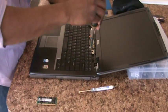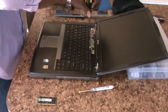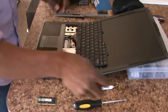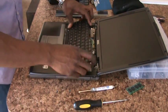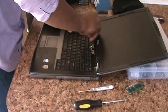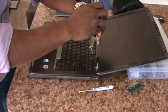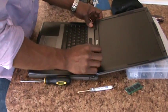First, remove the cover and remove the 2 screws holding the keyboard in place. Push forward on the keyboard, pull up, pull out. Press down on the memory, remove the first 512MB stick, put the 2nd stick in, make sure it's firmly in place, then slide the keyboard back in place and put the screws and cover back on.